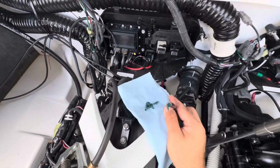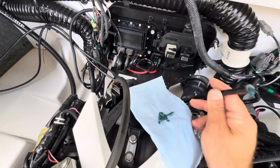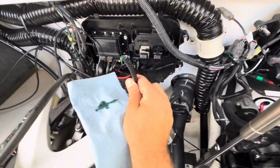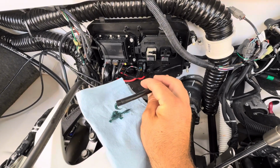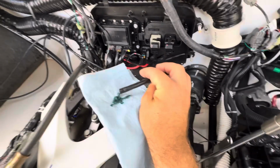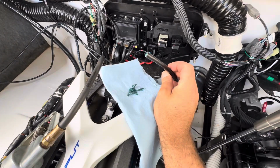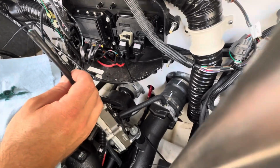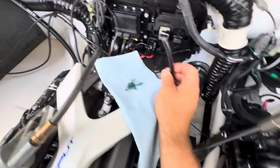Okay, so a second ago I said I was going to pump all the old grease from this hose that I just disconnected from the intermediate shaft bearing. I said I was going to pump it all out and pump it full of fresh grease. However, just did it like 5 pumps, and the grease looks brand new, just like I did it 100 hours ago. So I'm not going to pump all the grease out of this hose. I'm just going to hook it back up and do a couple pumps in the intermediate shaft bearing, and we'll call it a day.